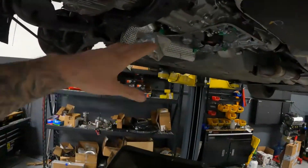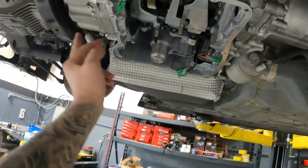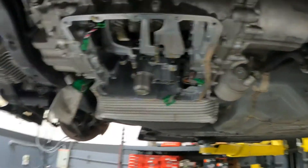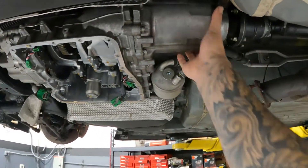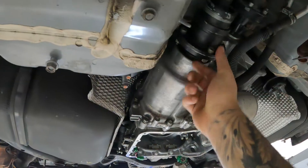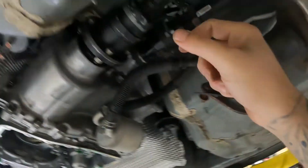Guys like Shep are making over 3,000 horsepower and still using the GR6 unit, which is very impressive. Now there are three sections to this: the midsection, which houses all the gears and shift forks; the front section, which houses the ETS unit. The ETS unit is the front clutch pack — this is what transfers power to the front of the car.